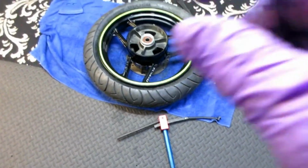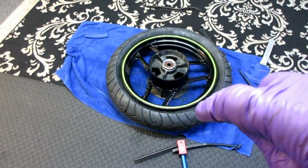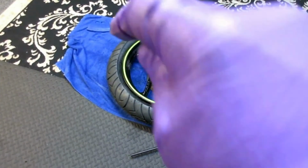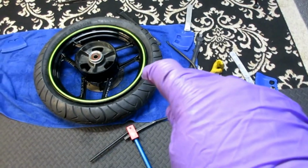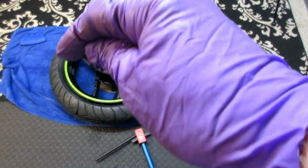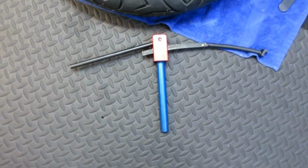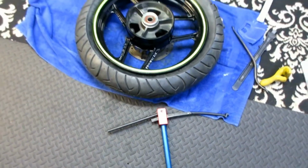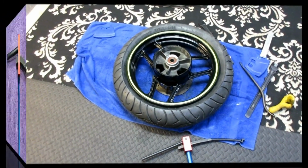It's a little tricky because you've got to get the tire on to the point, let's say from 10 o'clock to 2 o'clock, and get your knees pressed down in the case of the Sport Demon. Otherwise, when you start pushing that up with the tool, it wants to start loosening the other side. So what I did, you can look back at the video, I put the dog bone there. That kept it from walking the tire off, and then I just worked it this way. And that seemed to work fine. But hey, it's the first time I used the tool. It definitely works. And that was my objective, to see if you could mount a sport bike tire with the Bead No Pinch. And apparently, that's been put to rest.